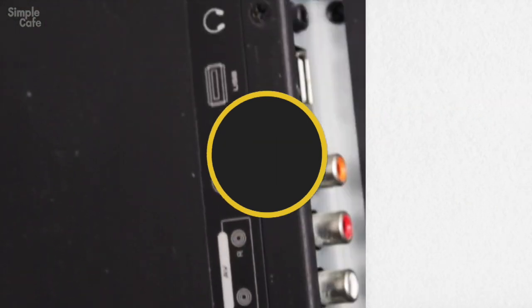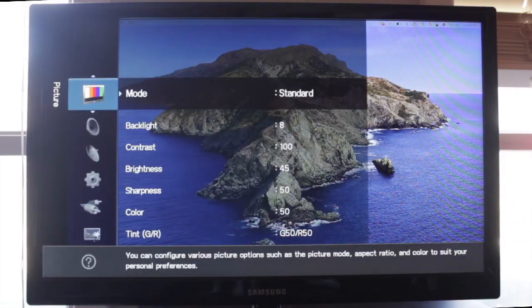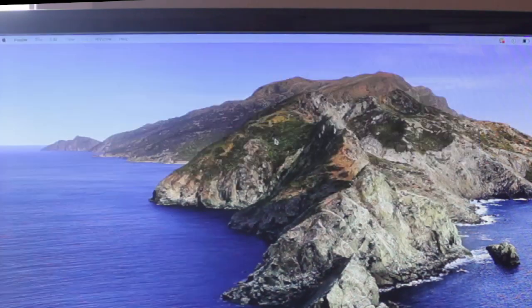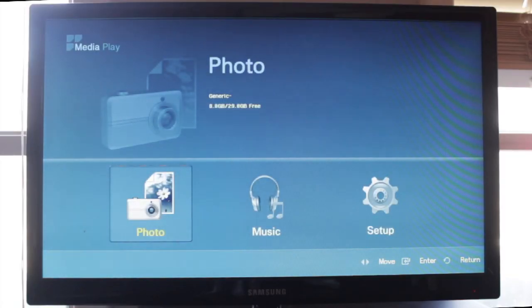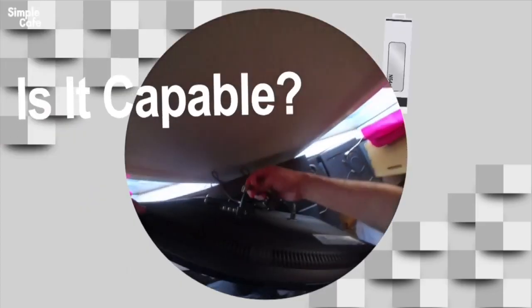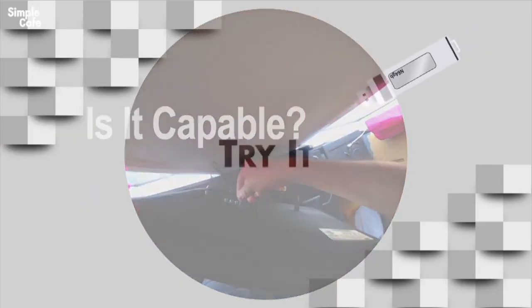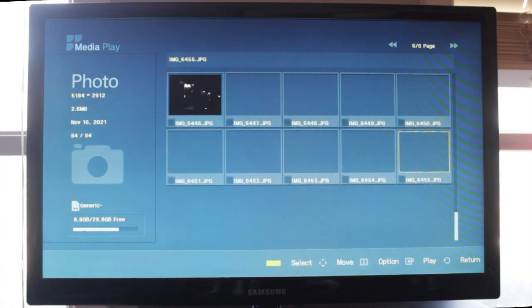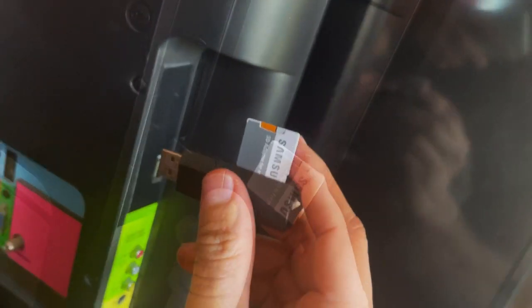So about your TV's port, the best way to find out if this will work is if you've seen a USB option in your TV menus. So have a look around in there, or to be positive, try connecting any other USB thumb drive with pictures in it and see if your TV responds. Or again, look to access the folders in the TV menus. If nothing comes up, well, don't waste your money on this adapter.